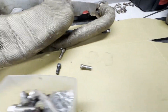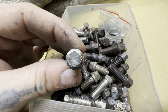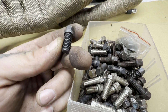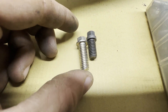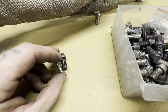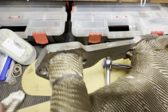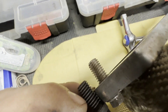I've got a couple extra bolts - where did they come from? I don't know, over the years I just keep stuff. I got a bunch of newer ones like these. You'd be half tempted to use something like that, but I'm pretty sure these ones came with the headers, so I'm gonna try these ones out. Also be aware of the length - make sure you test them by hand, check your thread depth before you start tossing stuff in there. Typically the longer the better for holding, but the higher risk you run of having those seized up. It depends on how thick your flange is depending on your header type.